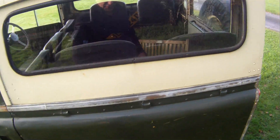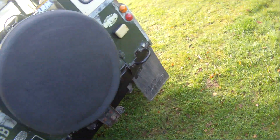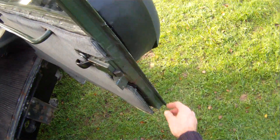Front seats are in quite good shape — no nasties on the seat bases or backs at all. It's all matted throughout as well. A few bits of paint loss on the nearside rear wing. Around the tail end, the crossmember looks to be in good order from the back surface. A couple of the rear seat cushions have seen better days, with some vinyl splits on the ends, but it's all perfectly usable. The tailgate bottom frame actually feels pretty good, though it looks like it might have had a section let in on the back of it.